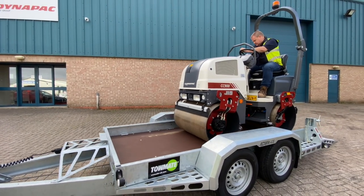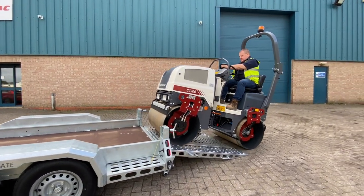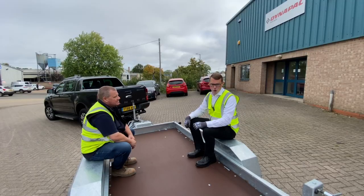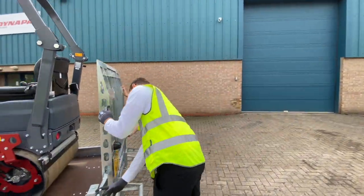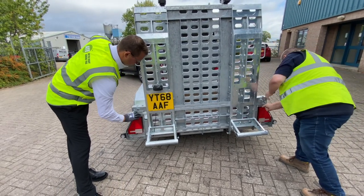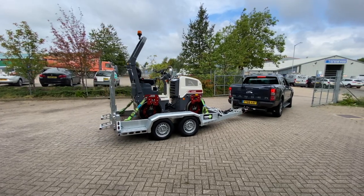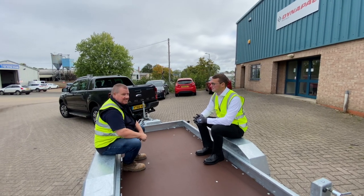Yeah. So the grip surface that we see on the ramp here is also available on the bed with a high grip surface, either the birch ply infill or a heavy duty GRP high grip surface. There are also many options on the ramp as well, and different options to a singular ramp. There's also an option for a 1700 long, currently it is a 1400. So when you're moving about access equipment that has low ground clearance, that aids with smooth entry into the vehicle. It's also what we class as a double angle ramp, also 1700mm long, available in full width or individual ramp, which gives you that perfect transition into the back of the Towmate built rugged plant trailer. Brilliant. So yeah, lots of options for the customer. Let's get a bit of plant on it.